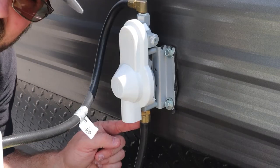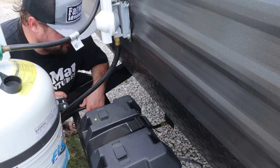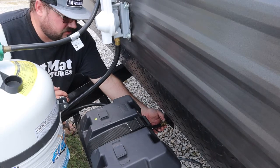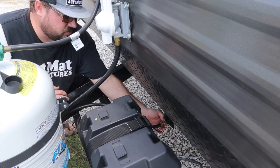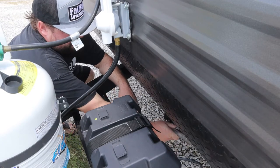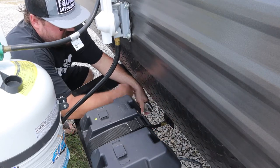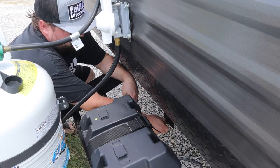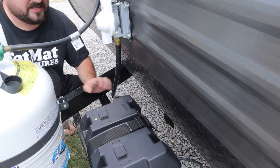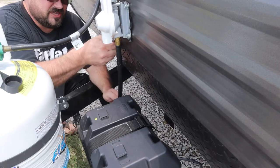I'm going to install mine right underneath the regulator. The next step is to disconnect this line from the regulator and the camper. I always recommend disconnecting it from down here first. The reason why is because this little connector here will twist while it's on the hose, and up here on this one it doesn't. I'm going to go ahead and disconnect this one down here first with a crescent wrench. Usually these are not very tight — once you get it to a certain point you can just disconnect with your hand. The reason I did that is because when I twist this one up here, the entire hose can twist and it won't turn into a jumbled mess.